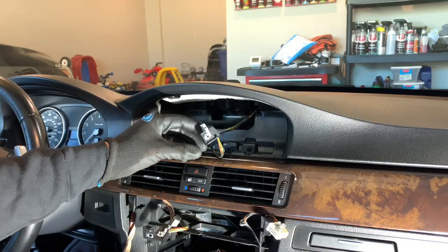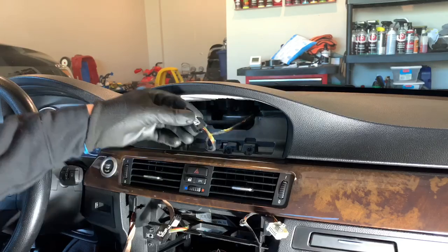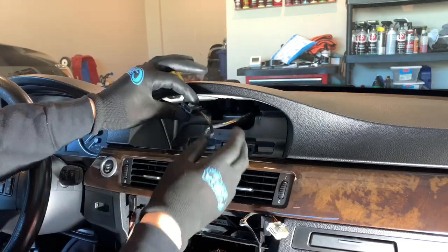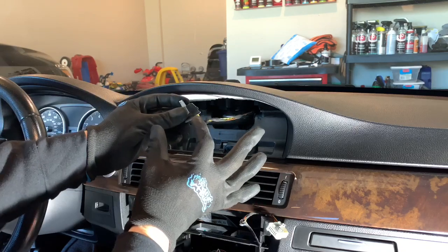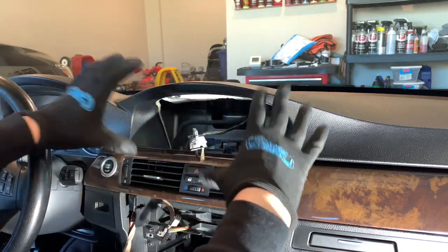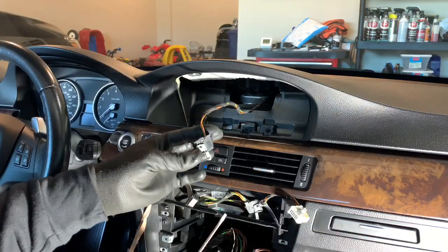All right, so what we need to do next is that since the CID is different on the CIC, we need to remove this from the slider and repin these wires to a new connector pin that will later go into the new CID screen display. So you have to remove the slider